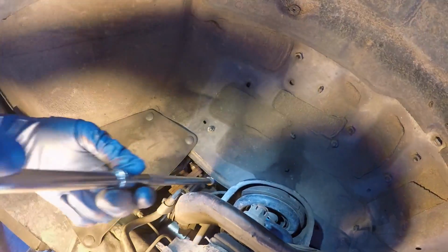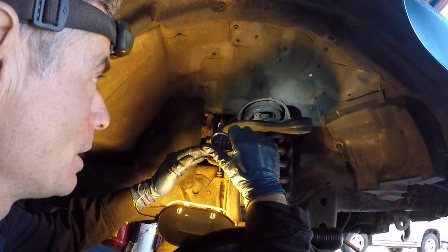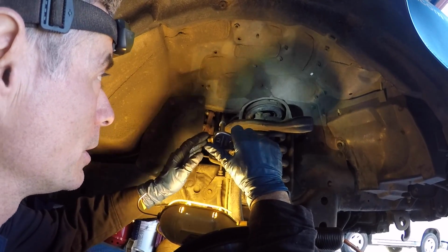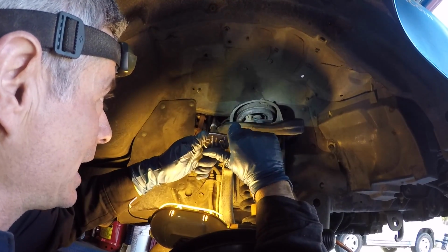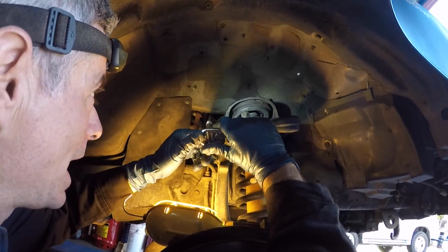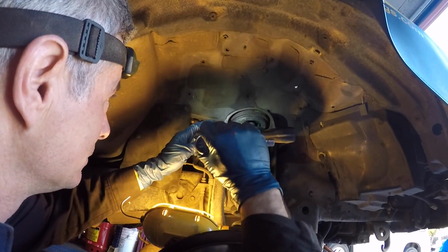All right. Now I could look up a torque spec for this, but I'm not going to bother with the torque spec for this upper dipstick tube holder because all it is holding is the dipstick. It's not that crucial. So just cinch it down nice and tight. I'm using very little leverage with this shorty 3/8 ratchet, snugging up, and I'm calling that good.